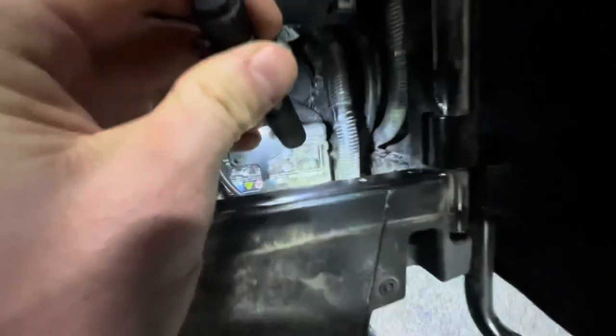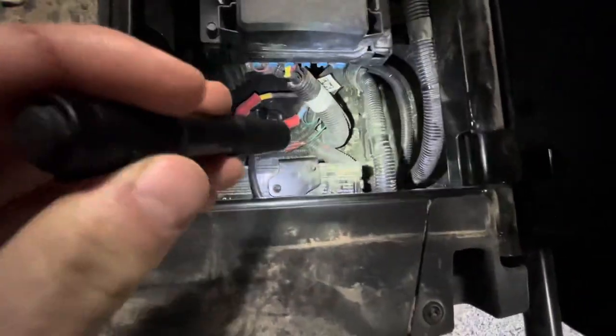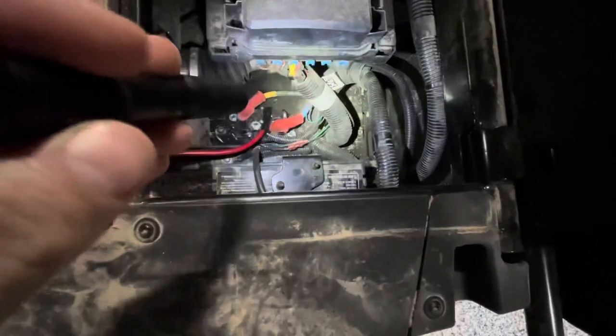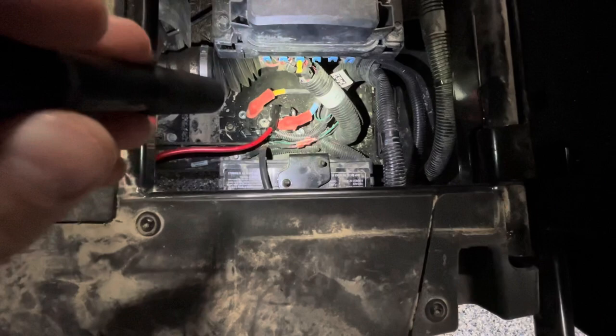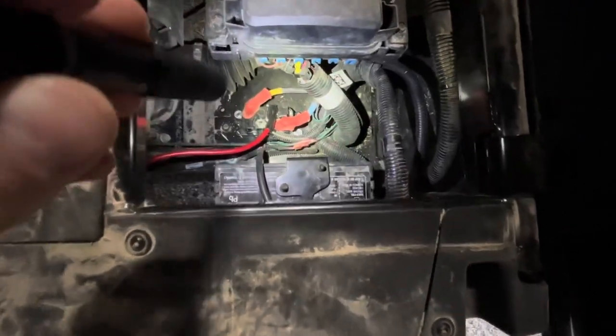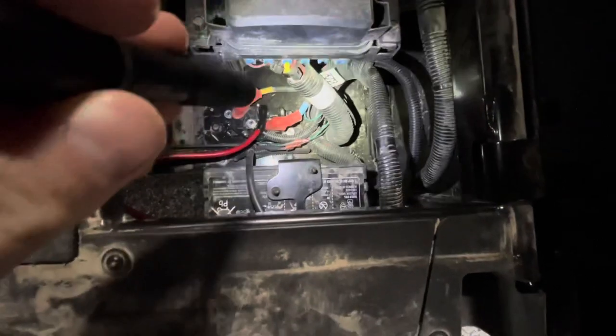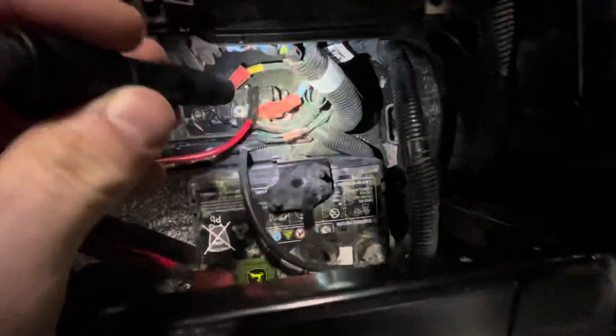And when you look at it from the factory, it's going to be tucked back here and it'll have two zip ties on it. So you'll take off those zip ties, and it's going to have the blue end — which is either positive or negative — going back to the front of the vehicle, that you're hooking into that plug-and-play quick connector. And your negative, your yellow, or vice versa. And then it has a ground — and that ground wire, though it doesn't look it, is actually quite short. That just runs back, and that's what's tied in right here.